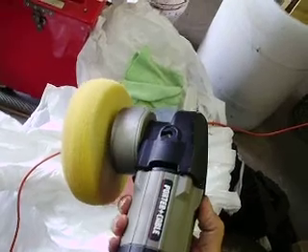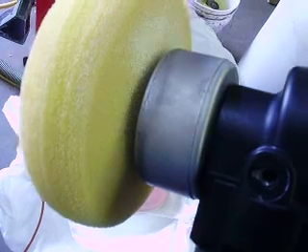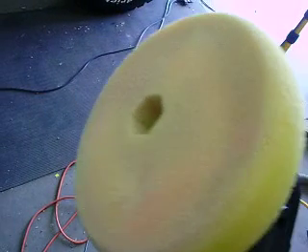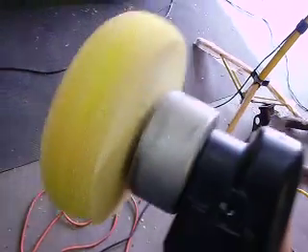After I buff it, I'll be using a Porter Cable Random Orbital Polisher. These are double-sided pads — really nice. You hit the little button, it pops out, and you flip it over. With this truck, I'm actually waxing with the yellow pad too. After I mirror glaze it, instead of moving on, I flip the pad quick and wax it.